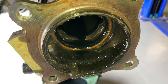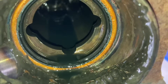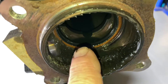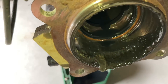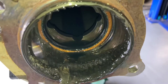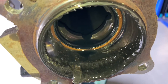What I want to do on this Hilux is see how long these rear wheel bearings will actually last — that's why I don't want to change them. But I might change this seal, because it seems obvious to me that oil is getting past the seal. There shouldn't be oil on the ABS sensor; it shouldn't come past that seal. All the oil should be on the diff side of the seal — this side is the bearing and the grease. Once you get oil to the bearing it can damage the bearing. Has this oil washed grease out of the bearing? How long has it been like that? There's going to be another job in this vehicle sooner or later.